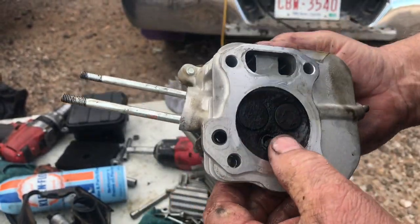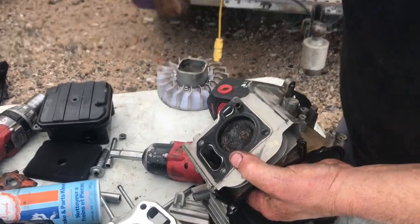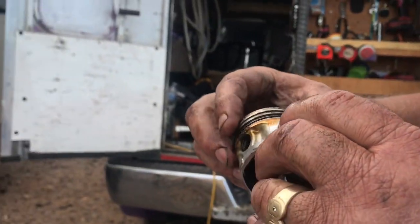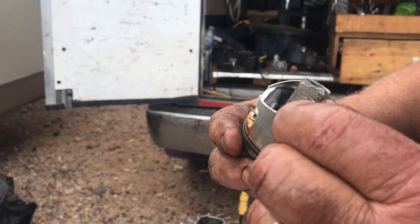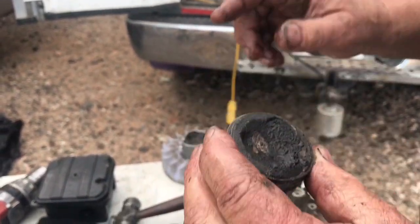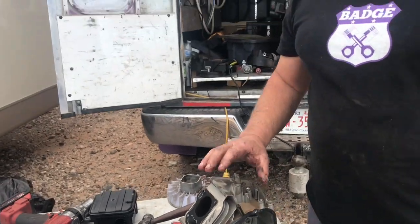That's the little head. Here's the piston - see the piston is seized, it won't move. The piston was seized in this. But all the rings aren't broken, but the rod's broken. That carbon buildup is because the rings were going out. It had lots of hours on it.